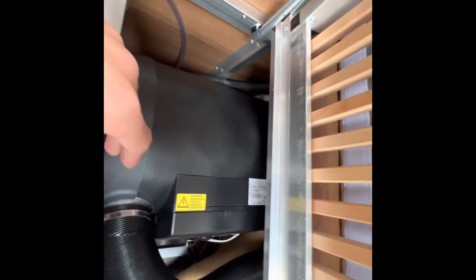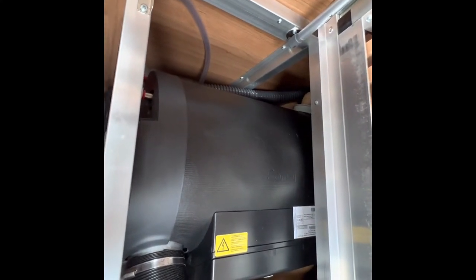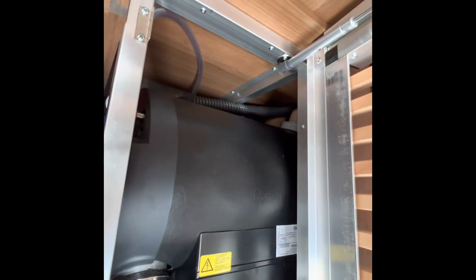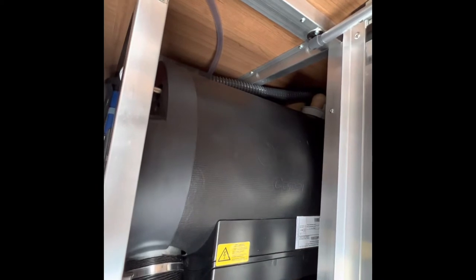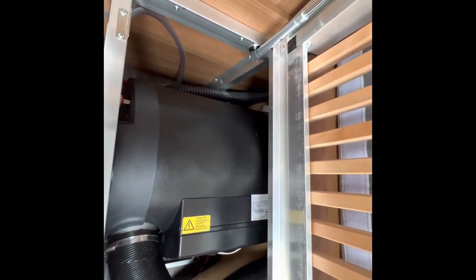To drain off your boiler, down the side here you've got a little yellow toggle. All you've got to do is lift it up and stand it on end — leave it stood up on end and it will stop water from sitting in the boiler, so it'll drain off the 10 litres directly out underneath the vehicle. Leave that stood up during the time you've not got the vehicle in use. When experiencing colder temperatures, make sure it's just drained down when not in use — regardless if you're using it in a couple of days, drain it off, because water can freeze.